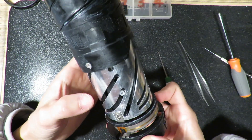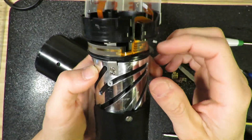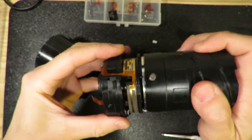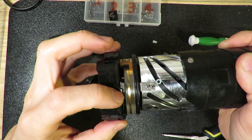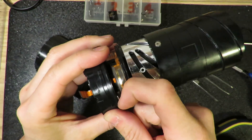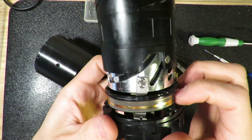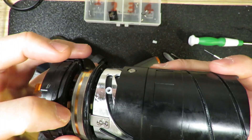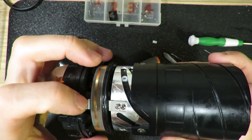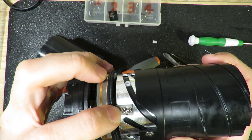That is missing, so I need to get it out. At this point I know what the lens problem is — why the zoom gets stuck. It's because of the cheap material. This is the zoom, and this is the arm. The barrel hooks up to these hooks and tries to zoom in and zoom out. But right now because of the material — everything is aluminum — these two screws that used to hold this arm are getting loose, and if I tighten it, it gets stripped.